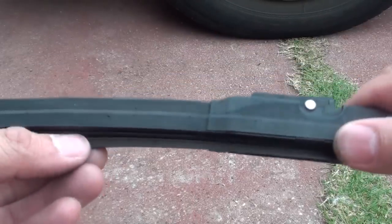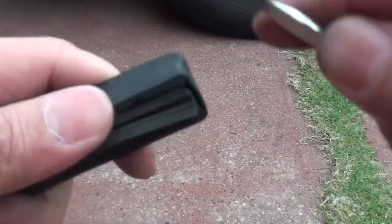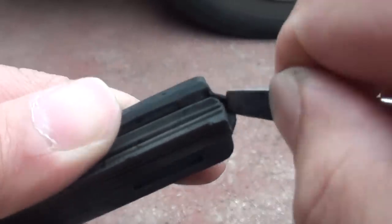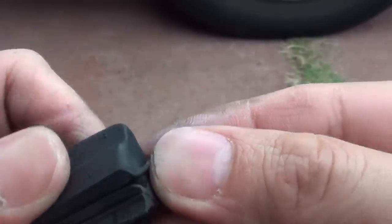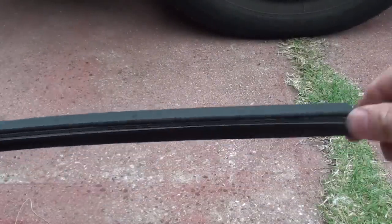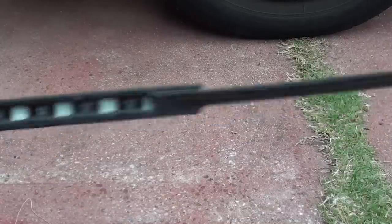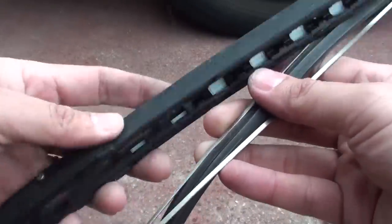After you get the blade out, we need to pull the blade out of the assembly part. Find one of the ends where it says the lock and then put your screwdriver at that end and pull it down. From here we're just trying to pull out the blade — grab it and try to pull it out, leaving this cap on. Keep pulling and it will come out like that — the blade and all the parts completely pull out.